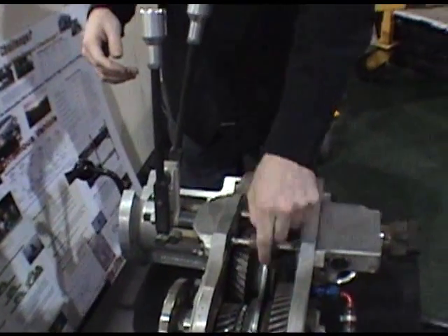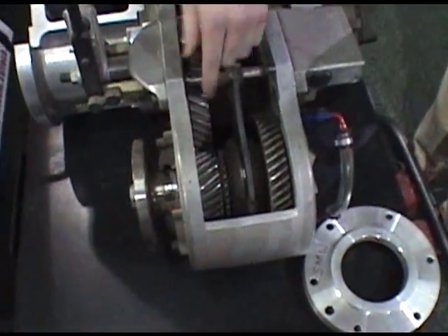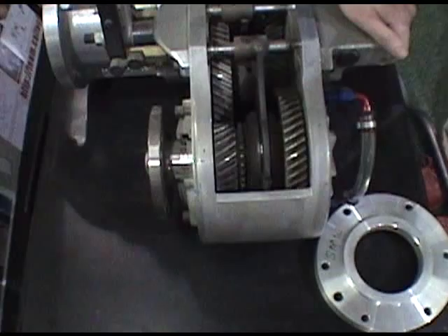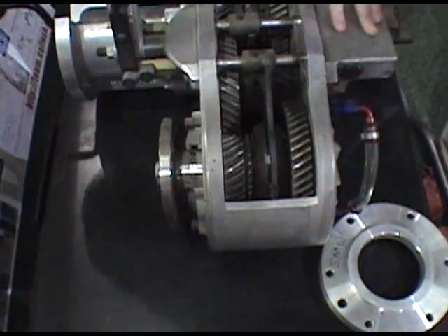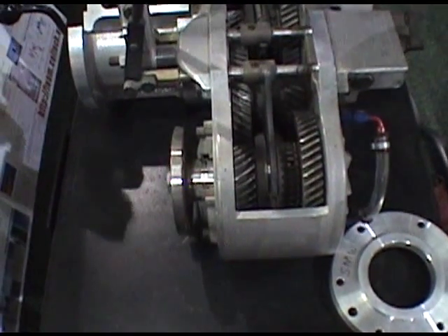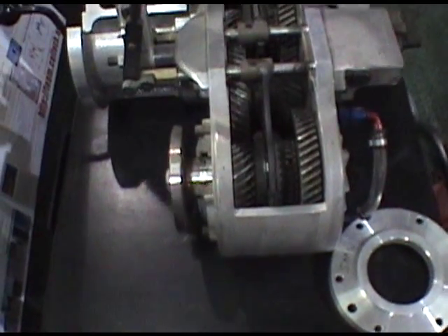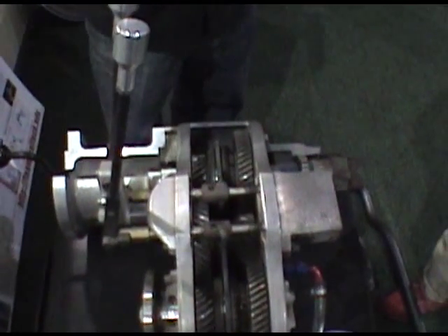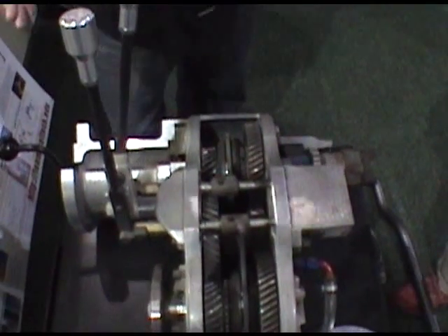What I really want you to see is what's happening when we're shifting. We have this plate right here that is sliding across a series of gears. When these gears are lined up nicely it's going to be real easy, but if they're misaligned just a little bit they won't want to shift in — that's why you may have to pull forward or backwards a little bit. It might not line up ten times you try, and then on the eleventh time it goes right in. The key is just to be patient with it; it's all mechanical, and understanding how that works is important so you know what you're feeling when you're shifting.